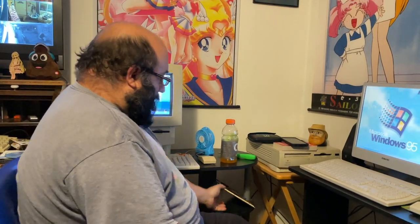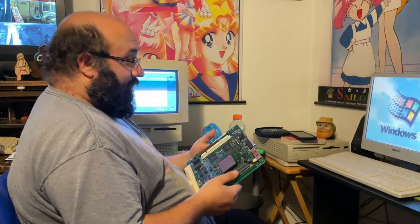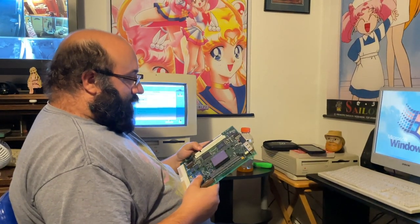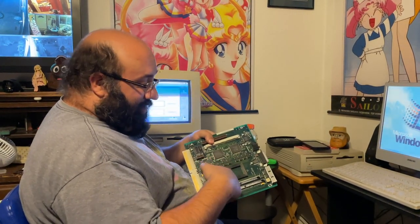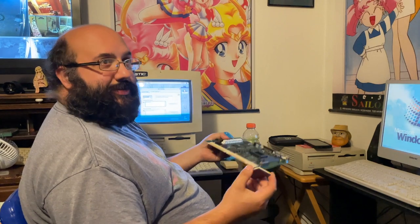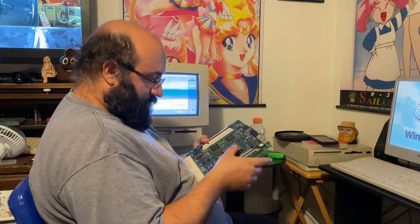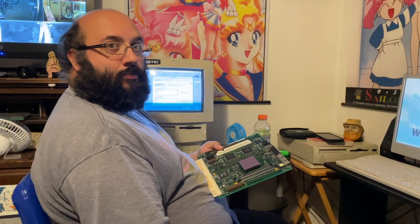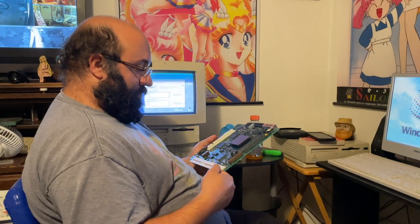One of the other funny things about this machine is when this came out, on a lot of these it said on the box 'Ready for PowerPC upgrade,' which is actually the logic board in this guy. So if you upgraded it to a PowerPC logic board, now you don't have this anymore. So now you can't use the DOS part of the machine. If you upgrade this to PowerPC, you just ruin the computer. There was actually a separate PowerPC upgrade for the 630 and 640 series board, but it plugged into the processor direct slot and the processor socket as well. So you would lose your PC compatibility functionality if you upgraded it with the PowerPC upgrade card.